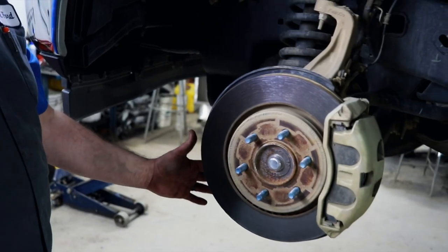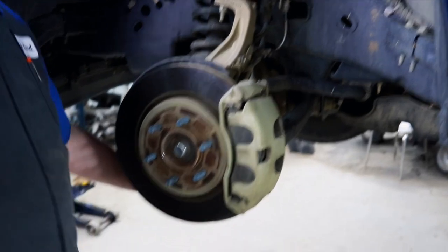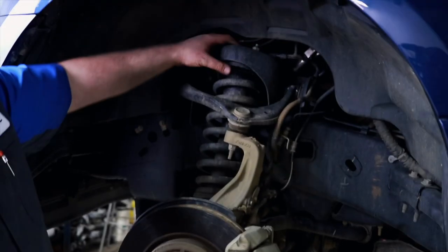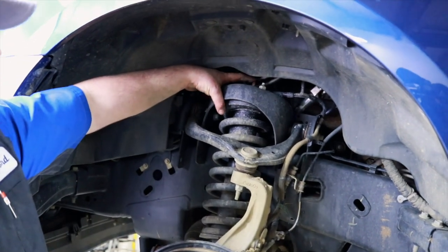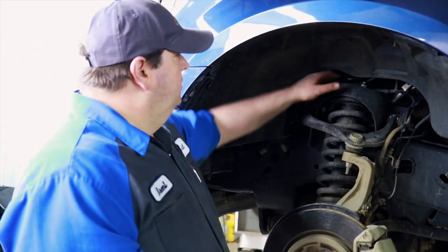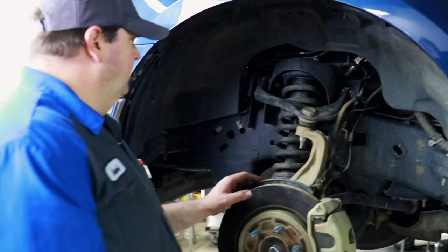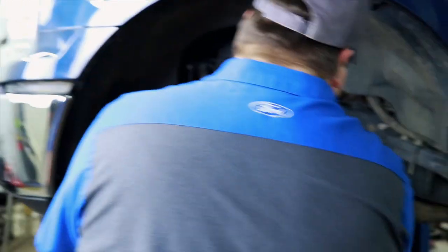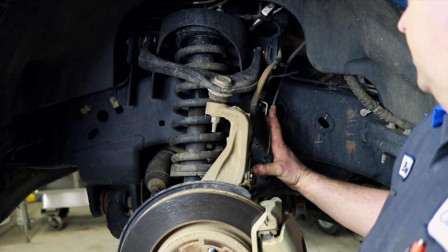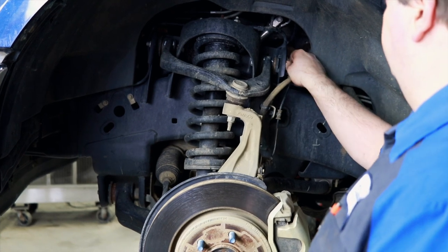We're going to unhook the tie rod nut, the upper ball joint, the two on the strut down at the bottom, the sway bar, and the three at the top. This middle one, you do not mess with it. Don't take it loose. When you take that one loose, that's going to let that spring fly apart, and very bad things will happen. Then we're going to unhook the bracket for the brake line in both places right here. And the vacuum line coming to the four-wheel drive actuator.